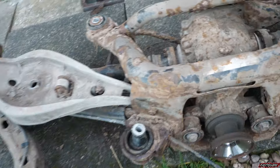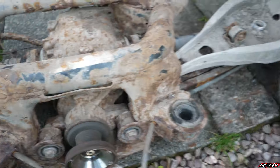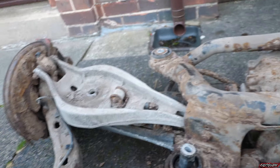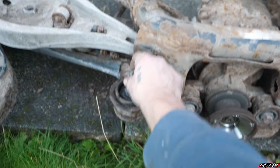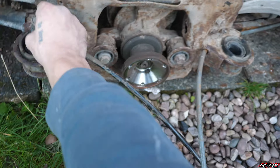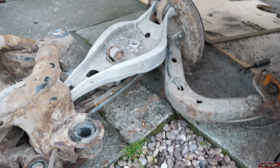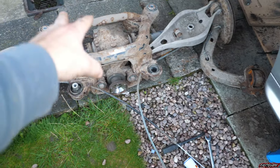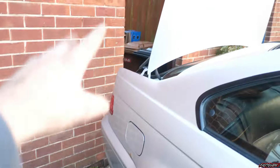So that's the current state of affairs. I was wondering whether to just wire brush and repaint all this, but I want to get it a bit more stripped and check it's structurally okay. I really would like to replace those trailing arms. I've got new lower control arms coming - adjustable ones. You can see these bushes have definitely seen better days - that one fell out as well. There'd been a little bit of clanking on and off the throttle, not all the time, and I wonder if that's what these were.